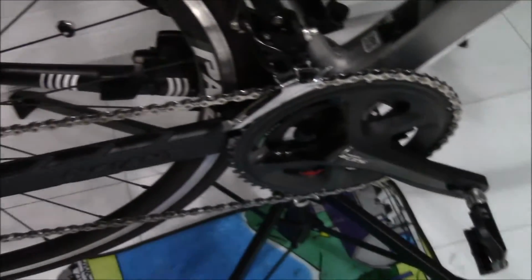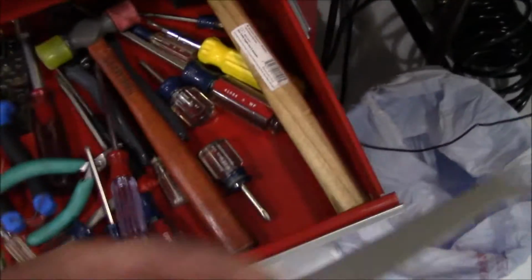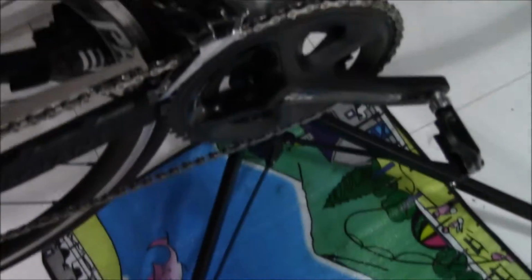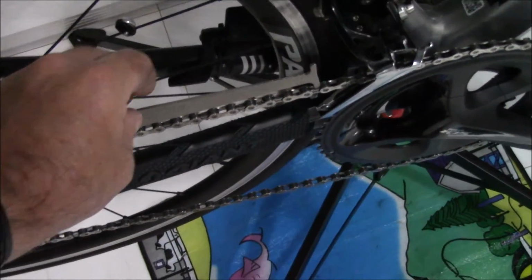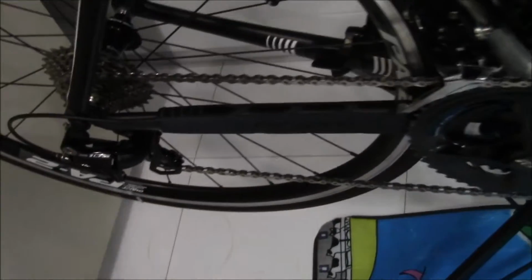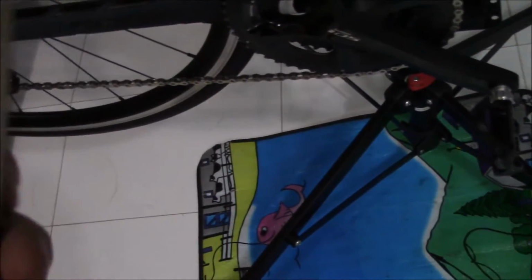And that way when your chain wears out, of course you can just take your chain wear indicator. I've done this in another video for you guys. Get your chain wear indicator out. You can go in and say, you know, this just ain't feeling right. It's feeling a little loose. Obviously this one is good, but it would drop down in there and indicate your chain's wearing out. It's at its limit. Take your chain off, put a brand new one on. You're good to go.